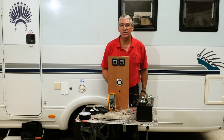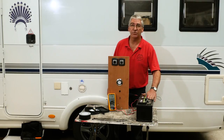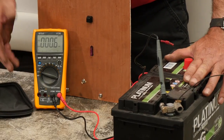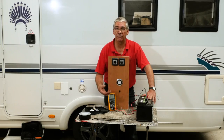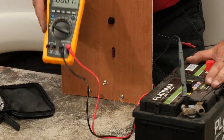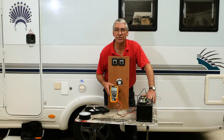It's a logical sequence of investigation needed to solve the faults. First off, make sure your battery is working — the meter will tell you. You can check bulbs, you can check fuses. It's all fairly straightforward stuff, but you just need to know what you're looking at and how to use the kit. Hope you found this helpful, and I'll see you next time.